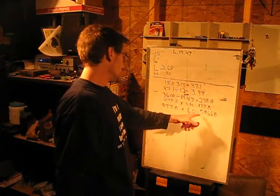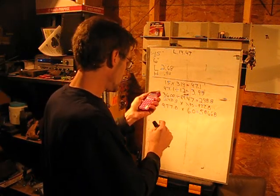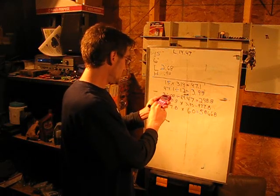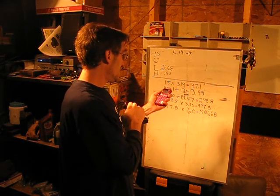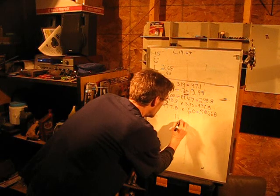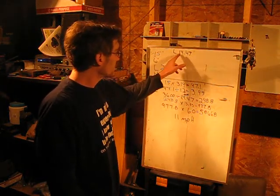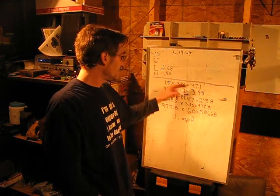So we'll take that 58,668 and divide it by 5,280, because there are 5,280 feet in a mile. That equals 11.11, so 11 miles per hour. That's the miles per hour you would be able to go with a ratio like that. But because we're dealing with the low, this is our low end, now we have to figure in the math for the high end.